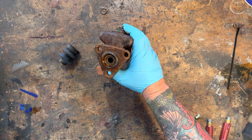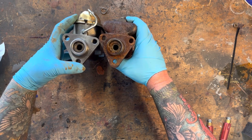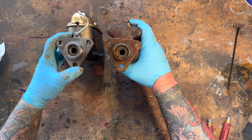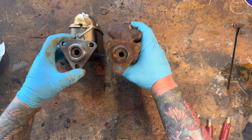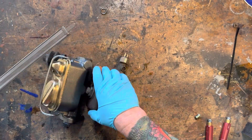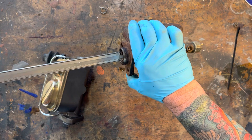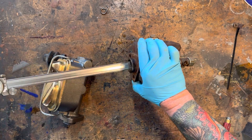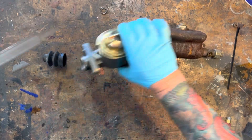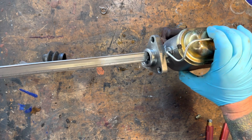One thing I was told to work with is the depth of this hole here — that's where the push rod goes in — to make sure the air gap is right. So I'm going to measure all that and see if I can't get it right on the first try. Breaking out my trusty depth gauge here. That one is going to be 1.5, and that one is going to be 1.3, so I'll have to adjust something there.